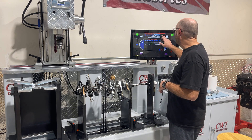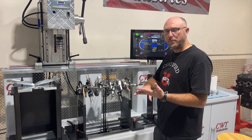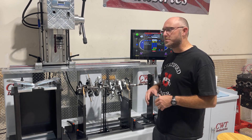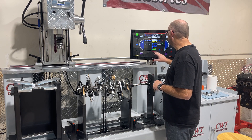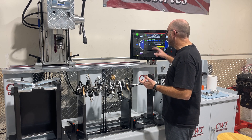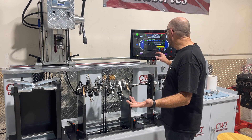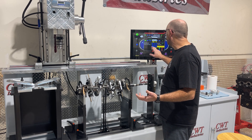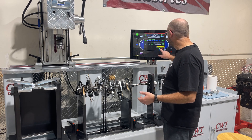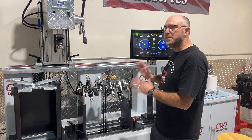So I went in and put in the weight of my rotor — that's my crankshaft, my balancer, my flywheel or flex plate, probably even my torque converter and transmission, all that kind of stuff. I use a value of 75 pounds here. My service speed — whatever you think the maximum might be, if you went all the way to hit the rev limiter — in my case that's 12,000 RPM. I know it's crazy, but that's how we roll. So then it asks if I want to apply this calculation. I say yes, and it gives me my tolerance: 0.118 ounce-inches for this particular package.